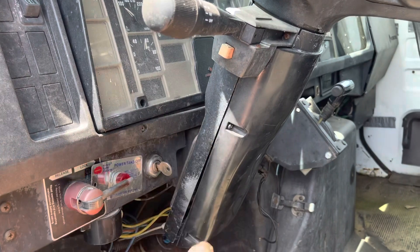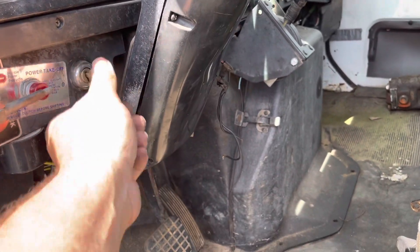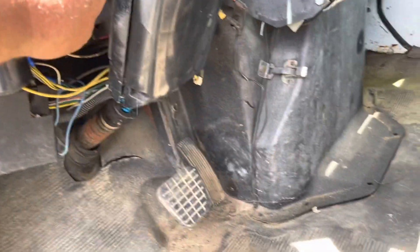As I was giving it a little bit of throttle, the truck tried to move in reverse. Apparently it is not in neutral. That's a little strange. I decided I want to shut it off because I don't know how much coolant is actually in it and I don't want to take a chance at overheating the engine. But it won't shut off, so I'm going to have to disconnect the batteries to shut it down. It's disconnected from the battery and it's still running — mechanical fuel injection doesn't need power to run, so I've got to shut the fuel off or shut the air off.